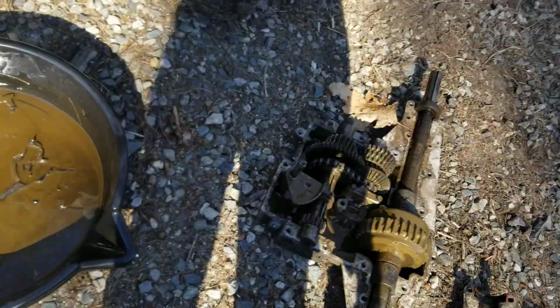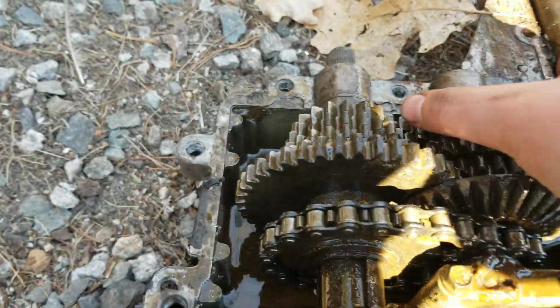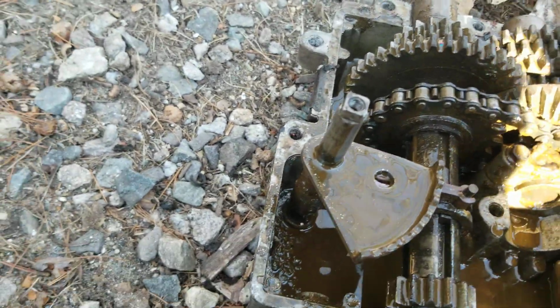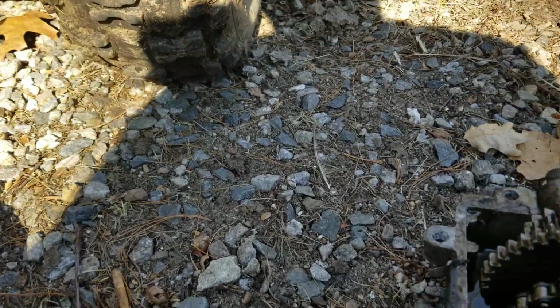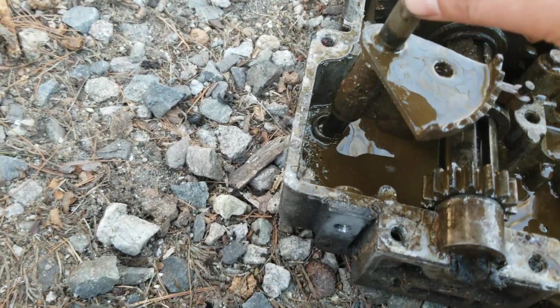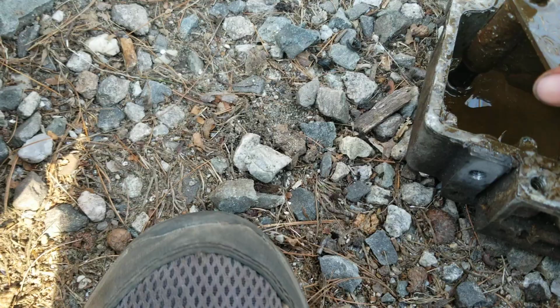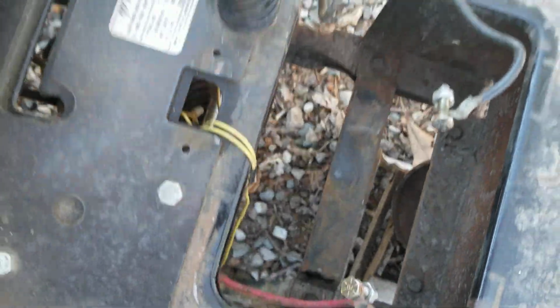Looking at this more, my reverse chain looks good, but look at this. All of these, this chunk of gears right here does not move. My shifter does semi-move. Oh, shoot. It does shift still. It's hard to move because, as you know, normally these are freewheeling until you select this. This moves up, moves this up, then it locks up which gear you want that you select, down in there and on this.